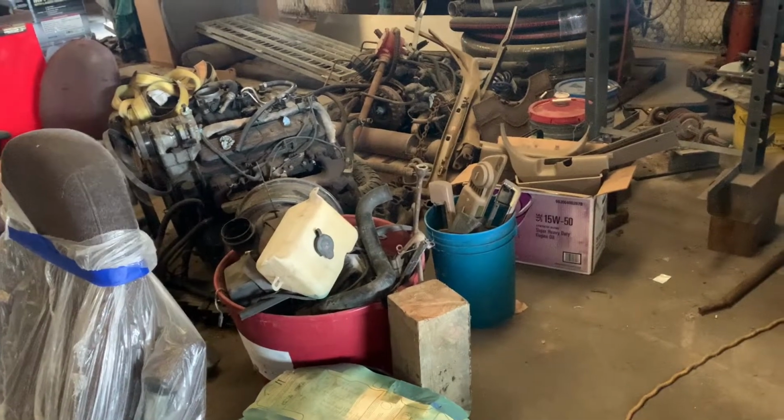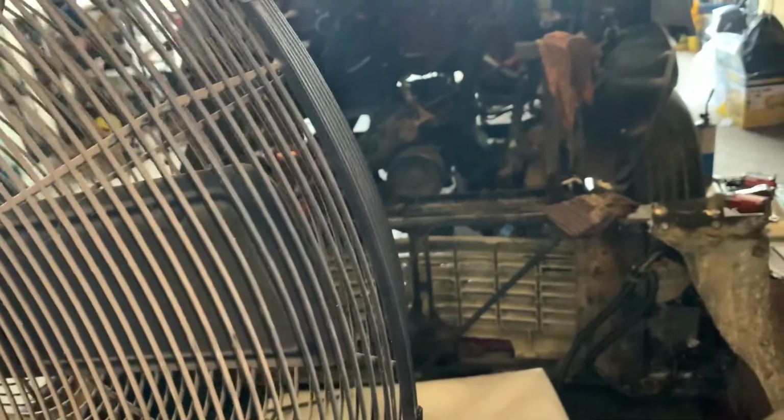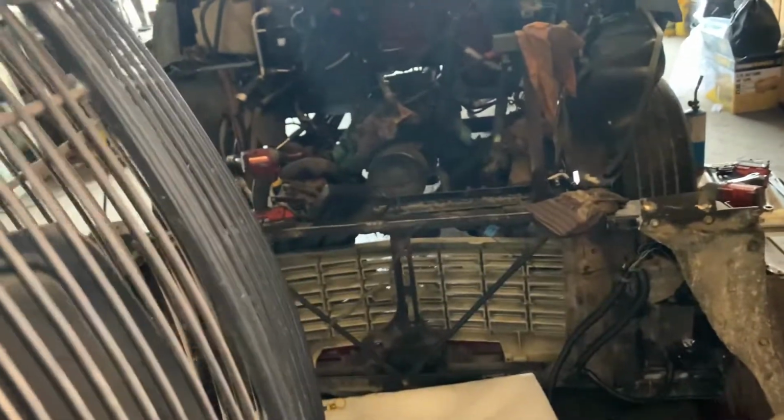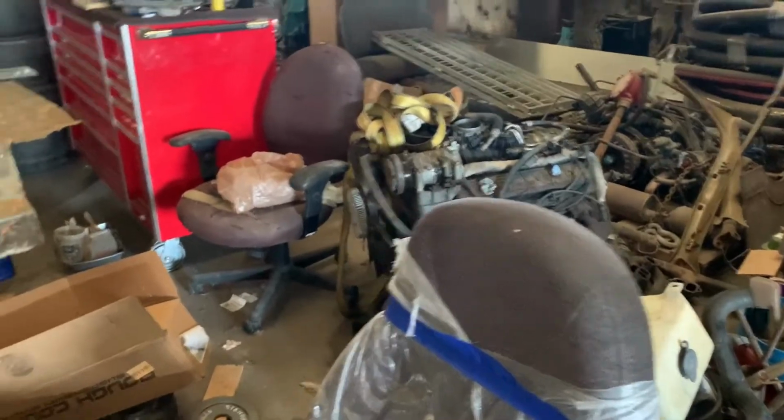Buy the complete kit. I don't know what size those pistons are. I don't know if they're standard, ten over, undersized, or what. But that cylinder needs to be bored out, because honing won't do any good. And those scratches are a little bit deep. So it needs to probably be bored over 30, maybe 40.